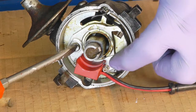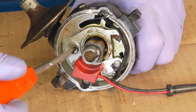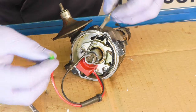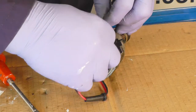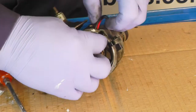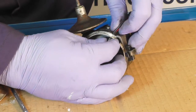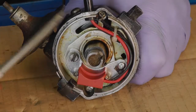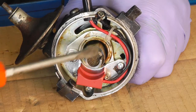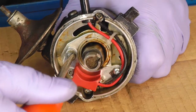We've refitted the cable and the longer screw. Just check that when you move it it's not straining on the cable too much and it's not so loose that it'll catch on anything else. We're going to thread the cables through the hole — just need to gently feed the next one through and then pull it through so that the grommet also comes through the hole. We've fitted the cable through, and using a screwdriver we can check that when it moves it's not catching anywhere.